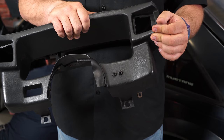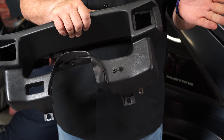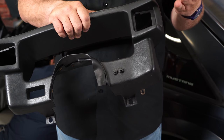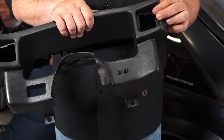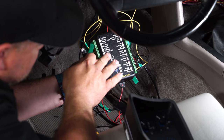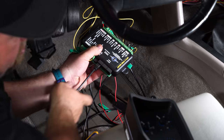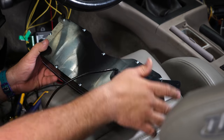While you're in the process of doing the wiring, you'll also want to install these two switches. One switch will switch between different RPM settings on your display; the other is for going into the menu and also allows you to do time, distance, and some other controls. Both are wired into the control panel. Find a good place to put them - in our case we already had an alarm hole drilled in, so we drilled a second one and put both switches right there. Now we're going to plug the cluster in and test it out. This cable can go into any one of the three plugs - it does not matter which one - and plug it into the back of the cluster.